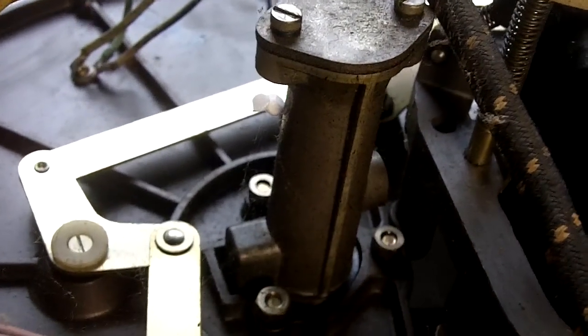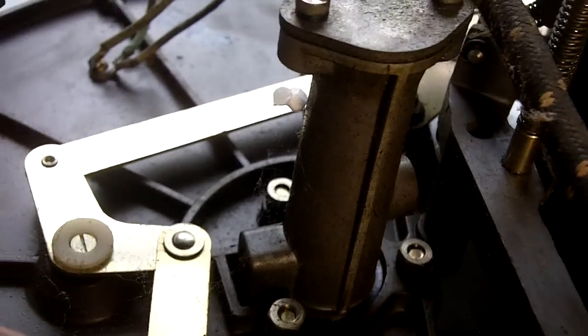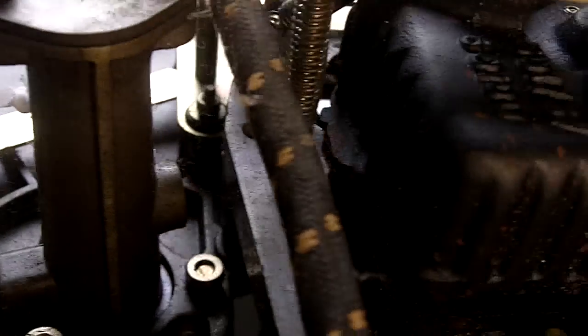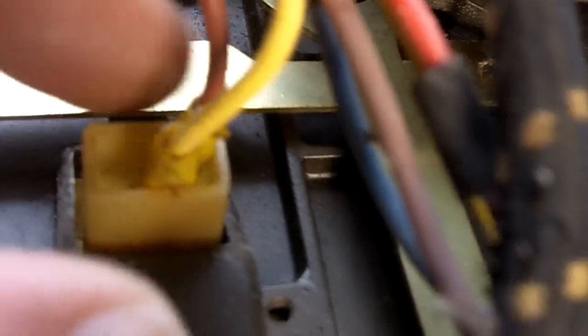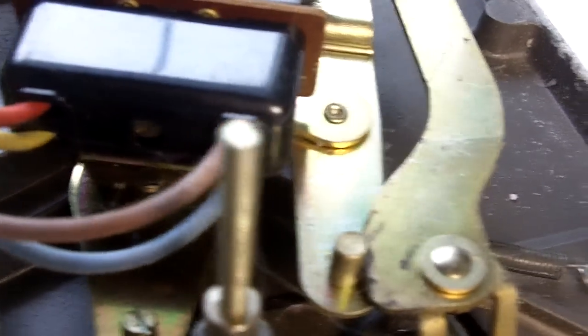Okay. Well, initially you'd think that the corrosion has escaped, but there's a great deal of rusting on the outer casing. Now, that's always a worry, because what that means is moisture's gone to the motor, and of course if there's moisture in the motor then there can be internal problems. I'm also looking at the electrical points here, and again there's rusting and corrosion, which tells me that there's been moisture going into the strobe, which again is a big problem, and the corrosion continues underneath unabated.